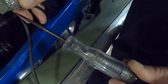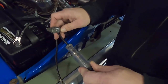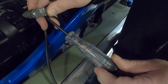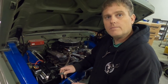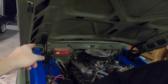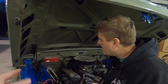You can see that filament is glowing, and when I disconnect it, it goes away. So we do have some sort of draw. Notice it gets really bright for a moment and then stays on — that's showing current flow, something causing that draw. My dad actually had a theory that it might be the MSD box being wired in wrong. He was in a wheelchair and couldn't fix it, but I remember him complaining about that MSD box.